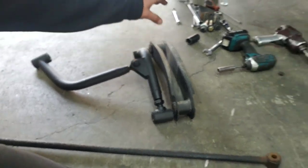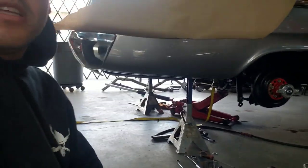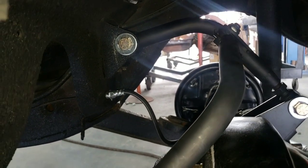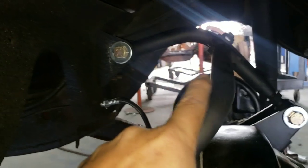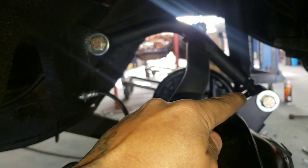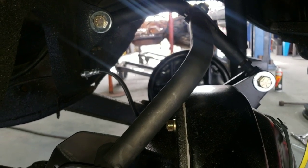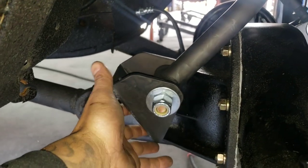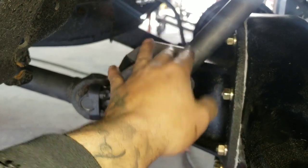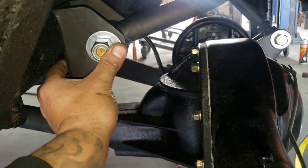I'm going to get this jacked up a little higher and get the first measurements going, then tighten the strap to get the rear end centered up perfectly. We went ahead and mounted the main crossover from the frame to the rear end. The top is tightened completely since that won't change; the bottom is snugged but still loose so we can correct the pinion later. Right now we're mainly focused on centering the rear end left and right. We already put the secondary bracket on — I like to do that before putting the y-bone up, as it eliminates headaches underneath the car.